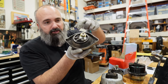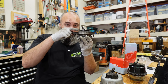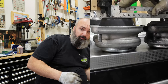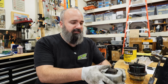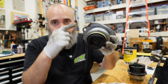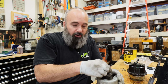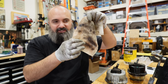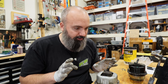In fact, this one you can still see oil sitting up here in the top. The mounts themselves were really easy to tell on the 540 that they had collapsed and sunk down, especially when placed next to the new mounts. These are a little bit more difficult, but what you can see is that the bottom here is all blown out. While it was in the car, it was actually a nice round bubble. And when I shake this, it goes all over the place and starts to squirt fluid out of this weep hole here. You can see the color of this fluid is this dark brown-black. It dries really weird on concrete.